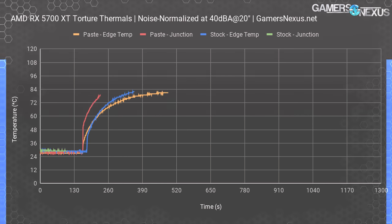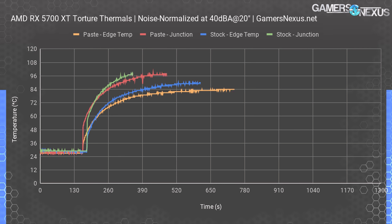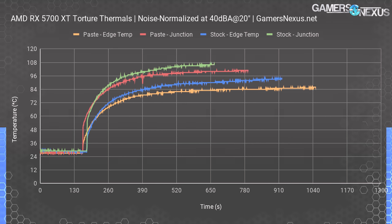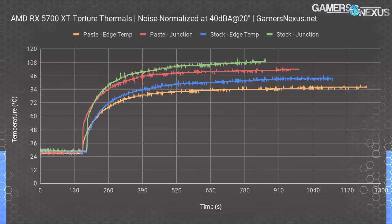An eight degree reduction in edge temperature from just adding paste and washers is a massive change for minimal effort. It's about four cents of washers, and if you buy some good paste, it's maybe another 10 bucks or so. We used our GN teardown toolkit and had the cooler off in about five minutes. The second time we did this, replaced the paste and had it all back together and working in under half an hour. So this is a pretty easy mod. As for the GPU junction temperature, we improved that from 110-112 degrees previously throttling down to 103 degrees Celsius — a major improvement meaning we're no longer clock throttling at 40 dBA. Technically this comparison isn't even one to one because the throttling clocks previously meant we didn't know what the true uninhibited temperature would have been — it would have been higher.